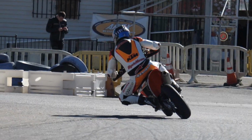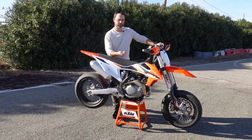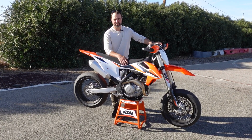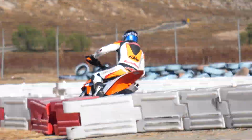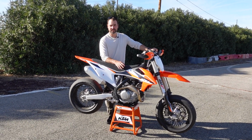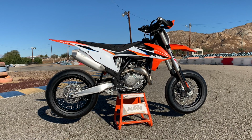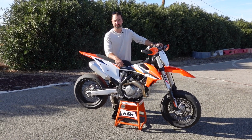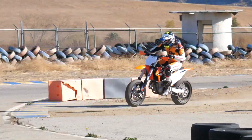The first map, number 1, is a little bit soft, and it sort of ramps up the higher you get. But map number 2 hits a fair bit harder. You know, switch traction control off and things like that. You don't need it on, for me at least. I don't think you need it on these things because it is so smooth, and there's so much grip at a place like where we're at, Apex, and from these Bridgestone tires. It would require a little bit of setup to get right. The spring is a little bit soft for me. I'm not actually sure what the spring rate is, but for example, on my 450, I've gone up two spring rates in the rear just to try and help the thing stay up and not tuck itself out and understeer away out of corners.